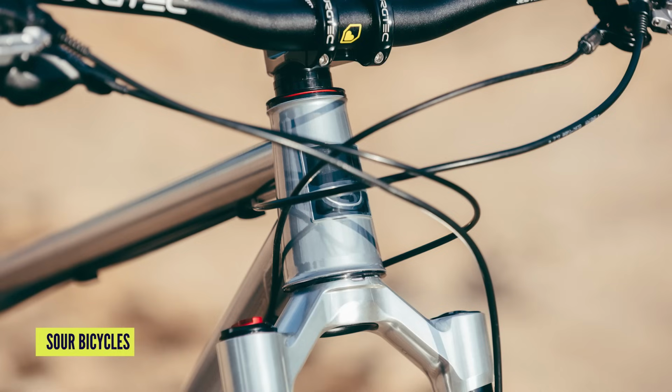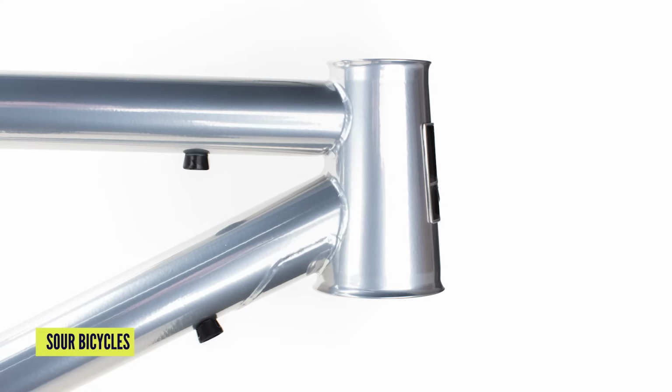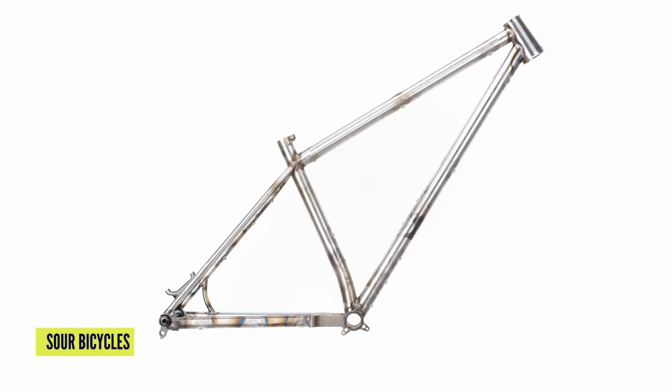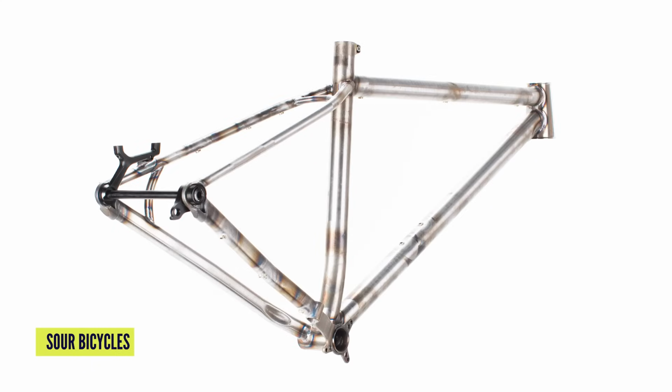They've got a 44, 56 head tube, which sounds a bit nerdy and boring, but it means you can run lots of different options of headsets and potentially even some angle sets. It's got the SRAM T-Type rear dropout ready already, 4 sizes, head angle with a 130 fork is 65 degrees, 75 degree seat angle. You've got 4 sizes with a reach running from 451 to 491.